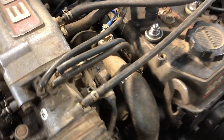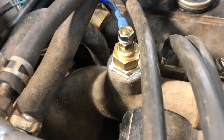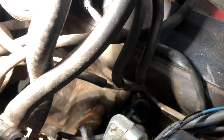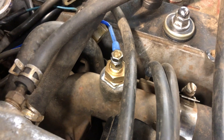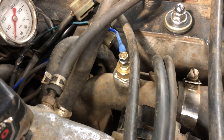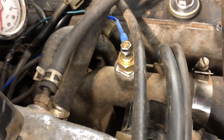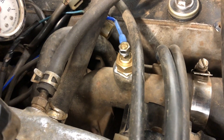Some models of 22RE even have a port on top of the thermostat housing. There's the thermostat right there, and right here is where I went to put in an adapter — that's where I'm actually getting my coolant reading from. That coolant reading will read differently than the gauge because the SR5 cluster gauge is reading it before it goes through the radiator and before it gets to the thermostat. However, this one is before the radiator but after the thermostat, so this one will stay colder until the thermostat actually opens and then coolant goes by it. I'm just using this as a secondary method to see how hot the engine is — I'm really only interested in the peak temperature, not necessarily how fast it's warming up.